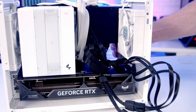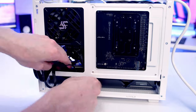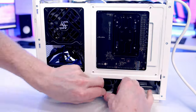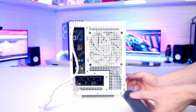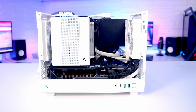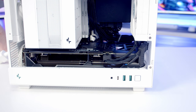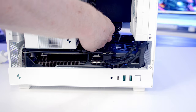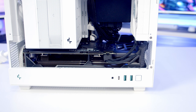There's plenty of space underneath the power supply for some of the cables. I wasn't happy with the initial cable management — the white cables didn't look great running across the top of the graphics card, especially with the black and white theme. So I unplugged all the case cables, passed them round the front of the graphics card and behind the black cables, and got them plugged in again, which looks so much cleaner.